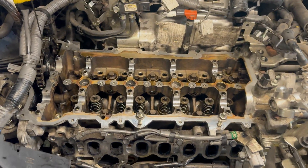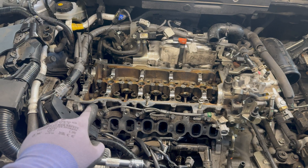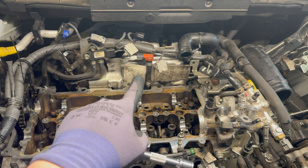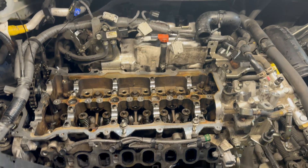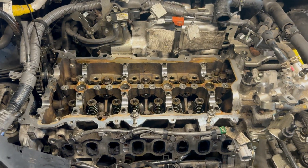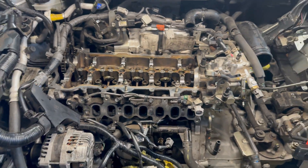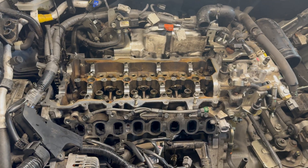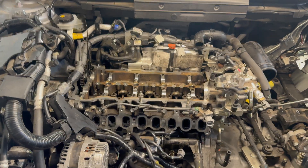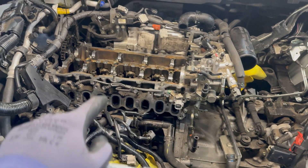This is how it looks after we cleaned it, and now the camshafts can go back in — they're still waiting to be cleaned. Meanwhile, the exhaust pressure sensor can be replaced and the pipe cleaned. Dan's going to do that, and after he's finished, he'll fit back the exhaust and intake camshafts along with the tappets and rocker arms. Finally, we can fit the bearings and the oil pump and oil sump back onto the engine block.